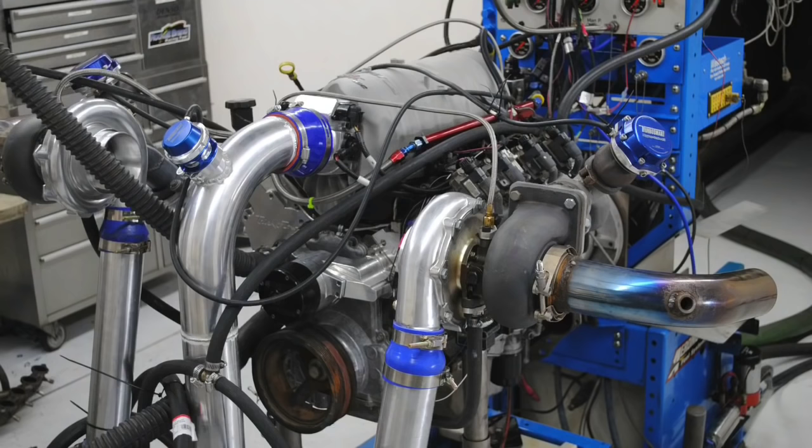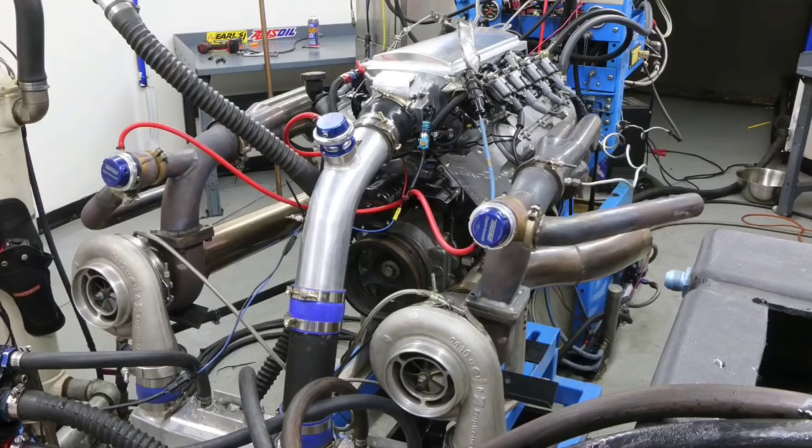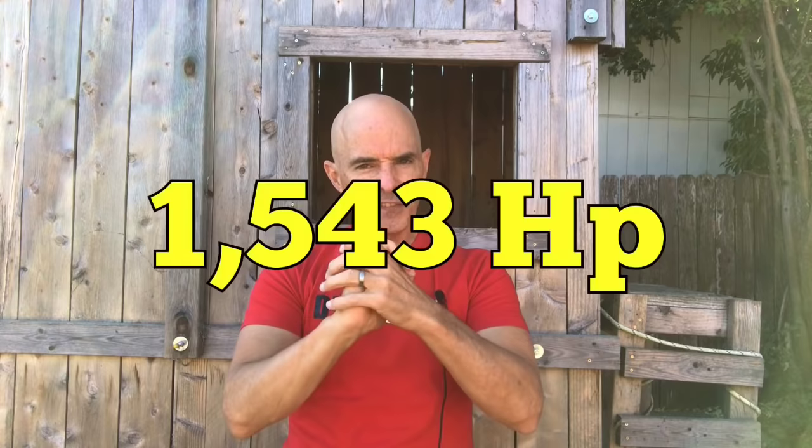Let's talk about the 4.8 and the 5.3 liter Big Bang series. I've run a 4.8, a 5.3, and the 6.0 — all the early Gen 3 stuff. I've also run a Gen 4 6.0, and that video is up right here — we made 1,543 horsepower with that Gen 4 LY6 motor and it's still alive. Someone sent me a five-bar MAP sensor because when I ran the Gen 4 6 liter I ran out of MAP sensor — all I had was a three-bar — and who knew it would take more than 29 pounds of boost to actually hurt the stock bottom end on a Gen 4 LS.